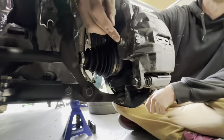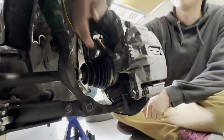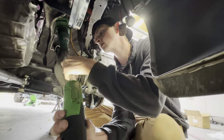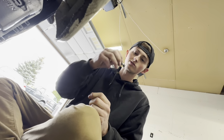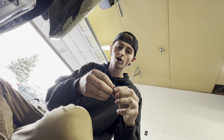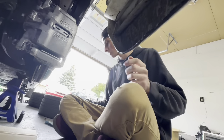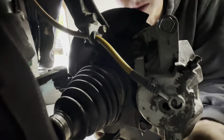There's a 14mm right here on the back for your brake line. We're going to set the 14mm to the side — it's got my two copper crush washers on it as well. Then there's a 17mm right here and a 17mm down right here — there's only two of them.